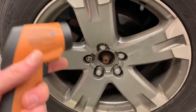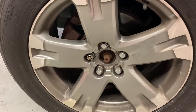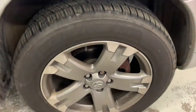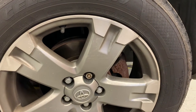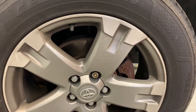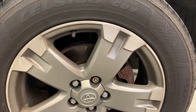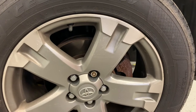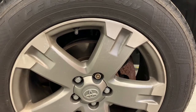Now I need to address the repair. I'm not going to mess around — these are brakes. That caliper is seized or sticking. I could try to take it apart, clean it, and lubricate it, but calipers are fairly inexpensive nowadays, so I'm just going to replace it. I'm going to check the rotors and might be able to machine them, but the caliper I'm replacing. I'm also replacing the brake hoses, since a hose is often one of the culprits. If you're replacing the calipers you're bleeding the brakes anyway, so you might as well do it right the first time — replace the calipers, replace the hoses, replace the pads, and either replace or machine the rotors, because this rotor is definitely going to be warped from all that heat.